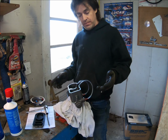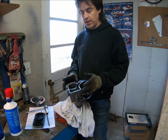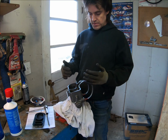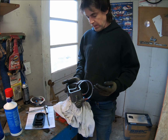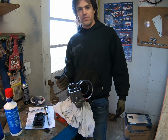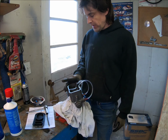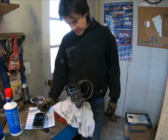So I was actually gonna end the video because I didn't have my master cylinder yet, and you have to replace the master cylinder usually when you go from drum to disc because of the partition, the proportion of the cylinder itself. So drums are usually 50-50. These are usually like a 75% to 25%, roughly. So I put it here on the vise and did our bench bleed.